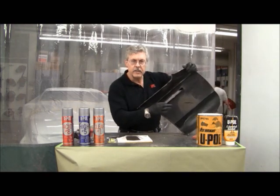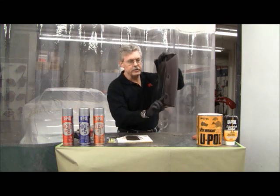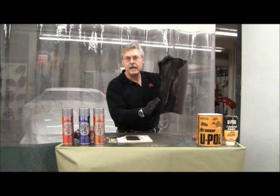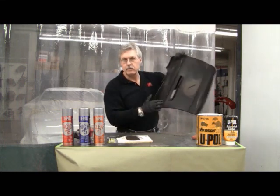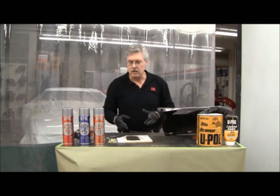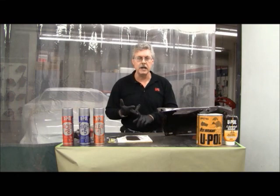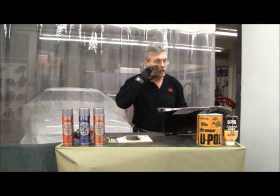We could have used mesh for this. Likewise, if we were working on a torn tab, that's another area where we would use mesh — sand it on the A and the B side, wrap the mesh up and over the top, spread the material on top of it. Once it's set up, we would come back and DA it down, drill a hole back in it or cut the tab opening, and we would have a repaired tab. We can do all of that without the use of an adhesion promoter. We don't need a tip, we don't need a gun. This product is excellent for any of the flexible bumper material that you're going to come in contact with.